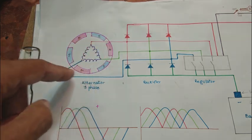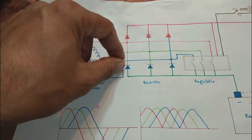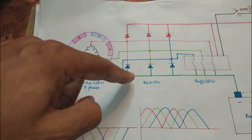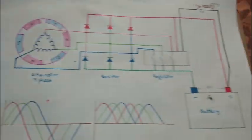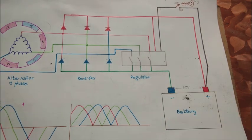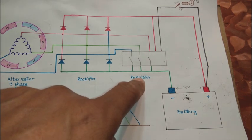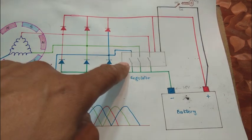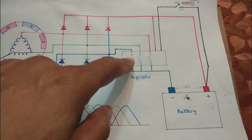The red, green and blue wires are connected to the rectifier. These six rectifier diodes make a bridge rectifier for the three-phase supply. The red line comes as positive and the dark green line as negative to the battery — the red line going to the battery positive post and the green line going to the battery negative post. Here is another part: the regulator part. This was the rectifier part we discussed.